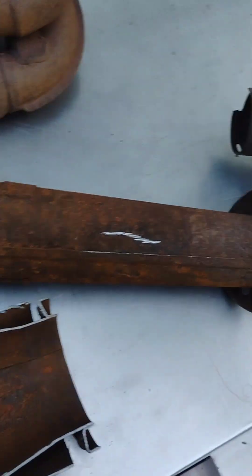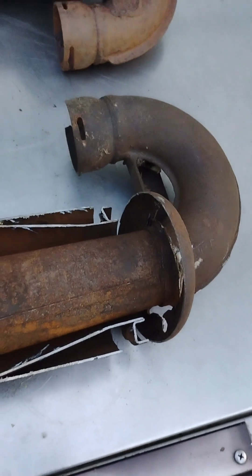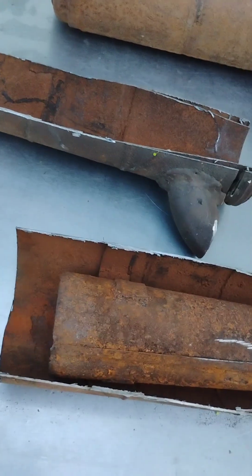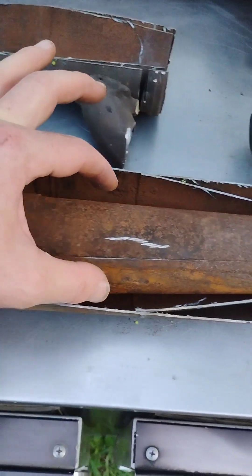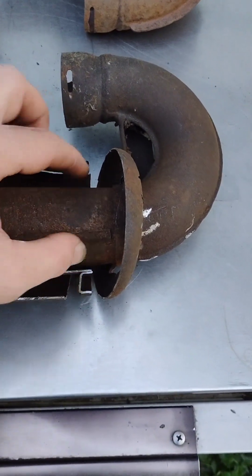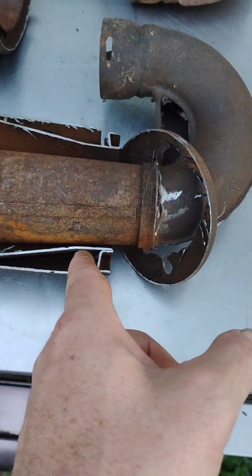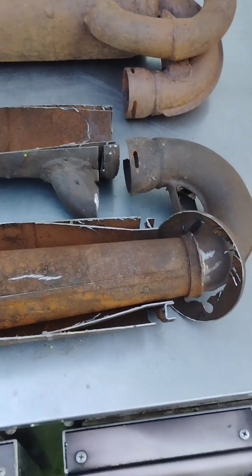I don't know if that makes sense, but I think that is pretty cool looking. When you piece this all together and you see how exhaust comes like this, megaphones, hits this turnaround point here, comes back, gets squished to push up against the face here, and then comes out and pops out our exhaust pipe right there. What a neat design.